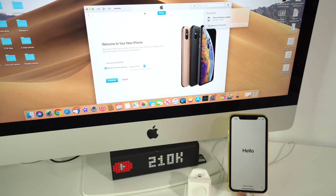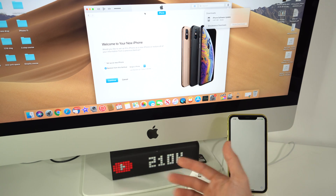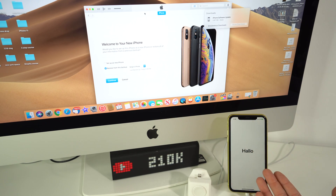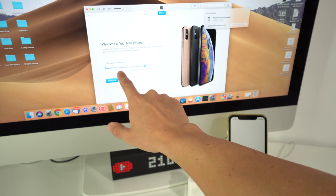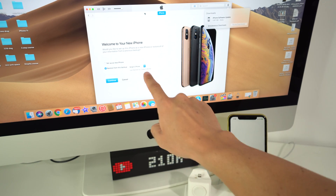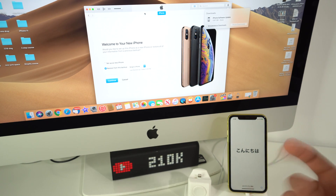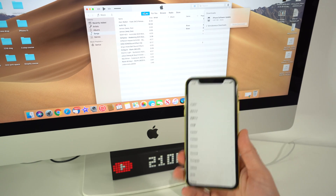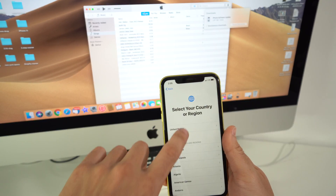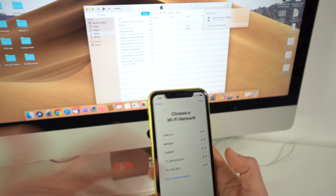And there we go — the iPhone has been completely reset. You can go ahead and unplug it. Also, if you were able to back up your phone before doing this to your computer, your backup will show up right here and you can just restore your phone from the backup. However, in most cases you may not have a backup. So if you don't, all you have to do is go ahead and get your phone — you can unplug it here and you'll have to go through all of these setup steps to quickly set your phone up.